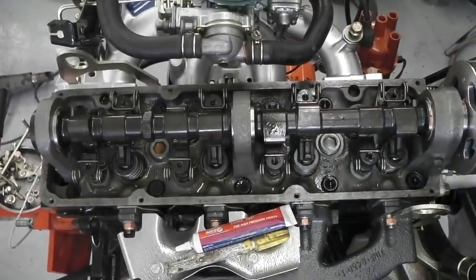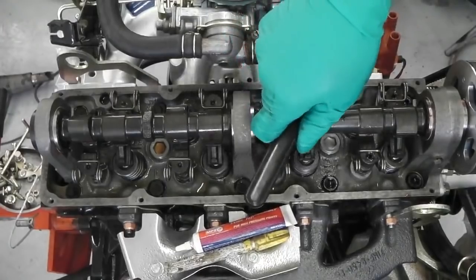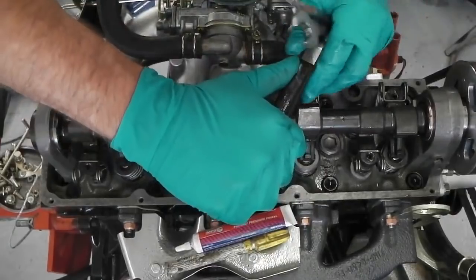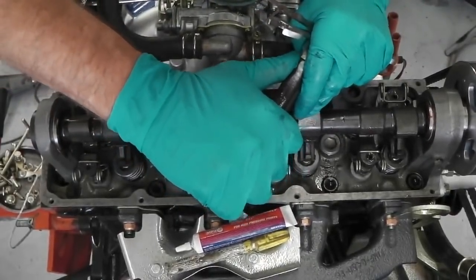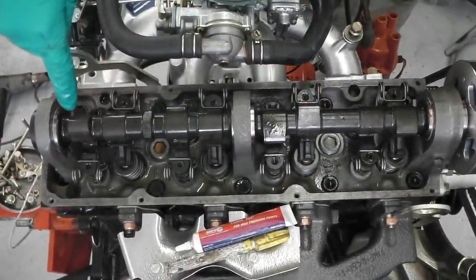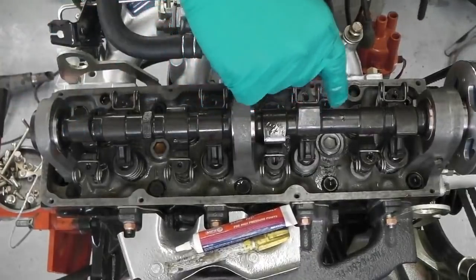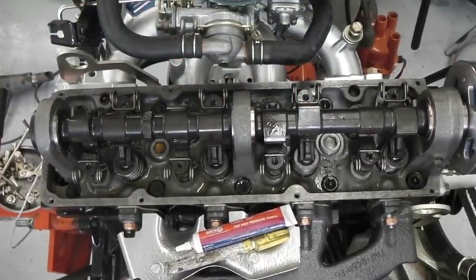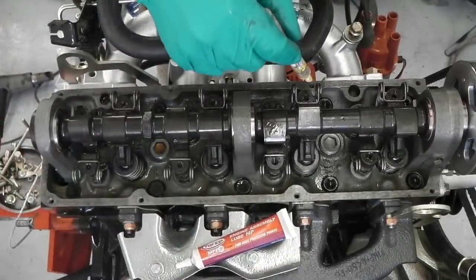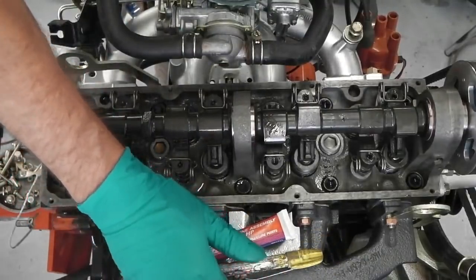That's okay there. So just lock the 19 back. So as you can see what that tool is for now. We don't really have a lot of torque locking them back. And that's locked. So that one is done. We can now do this one before we turn the crank and get another pair popping up. But we'll have to mark that we've set those now. I'm just going to mark them with my pen that they've been set. I'll rub it off after. Otherwise, you can end up going back on yourself.